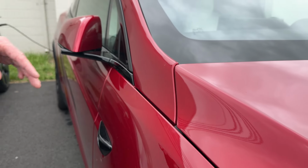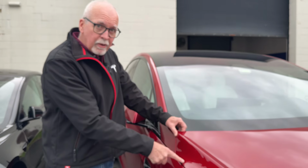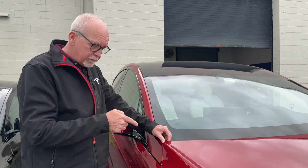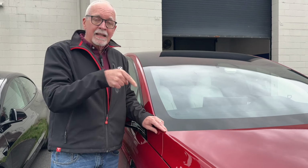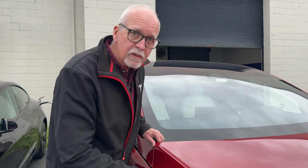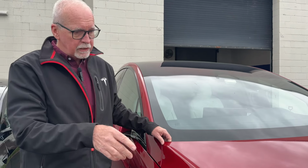So what does that mean? It means something's out of place. Is the hood out of place or is the fender out of place? And so if you think about it, because this panel's fixed, this gap here is as good as it can get, maybe could get a little bit better. It's not the hood that's the problem. Where most people would now go to start to adjust this hood, the hood's just the symptom. The issue is the front end of this vehicle. So let's take a look.